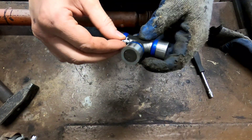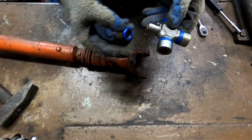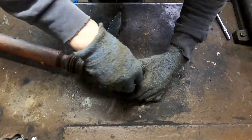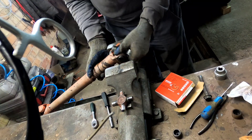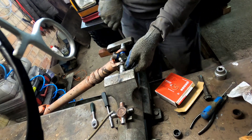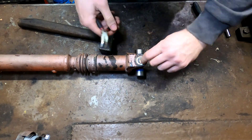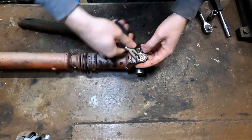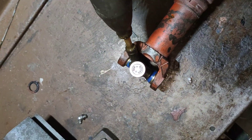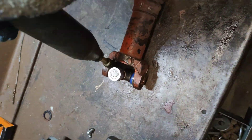Installation of the new one is straightforward. Added the universal joint inside the yoke and both bearing caps pressed with the bench press. The only struggle is to balance bearing caps to center for snap ring installation. The new universal joint comes with a zerk fitting, so it needed to be lubricated before installation.